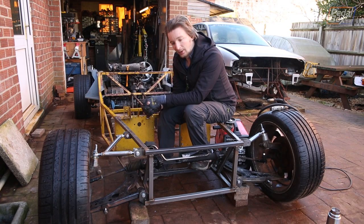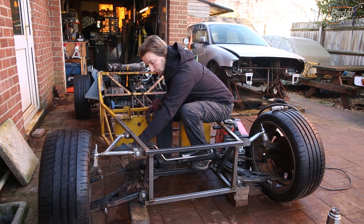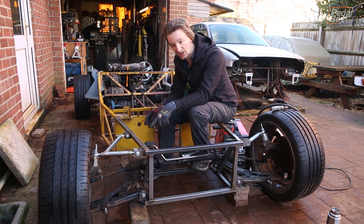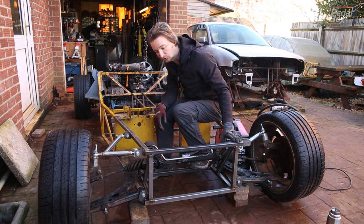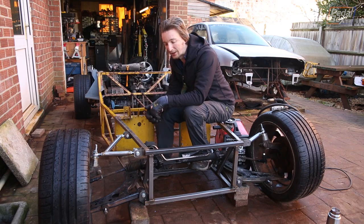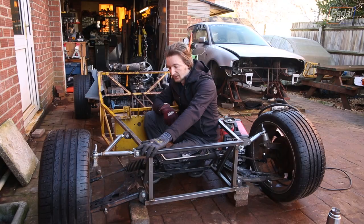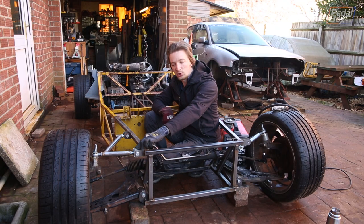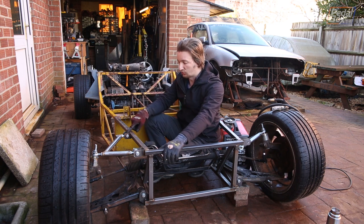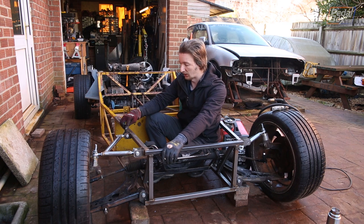Since we're not worrying about the anti-roll bar right now, we're just going to get back to the power steering rack for a second. This is tacked in place and the alignment all looks pretty good on our steering arms, so we're going to stitch that in, get that solid, and get the mounts tidied up. We're then going to cap off over the tops of our support braces, just because they're a bit ugly where we've got open tube ends. We're also going to tweak our upper arm brackets around a bit — on the front one here, we've got a bigger alignment problem where the front edge of our arm comes back quite far, causing the heim joint to catch while it articulates, and the rear joint is just a bit too far back. I reckon as we lean the front bracket backwards it will actually bring the rear joint into alignment, but we'll figure that out as we go along.